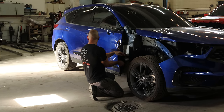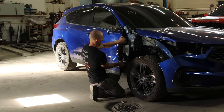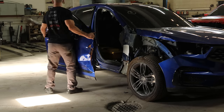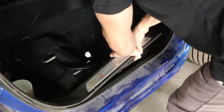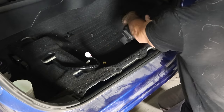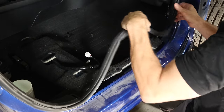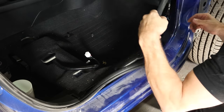Actually I chose right here because over there there's less room, and that's where it's going to end up when I'm done. All we have to do is pull our forward bolts out of our hinges — I never plugged it back in or put the door check in — then lift the handle and take it off. Probably could have done it blindfolded, but this is an expensive door to play that game with. We pull our sill plate out with a little wiggle and pull, get the kick panel out, pull the gasket out to expose the pinch weld, and remove the trim panel from the side of the dash.